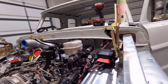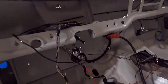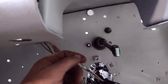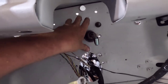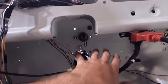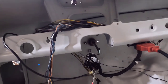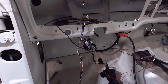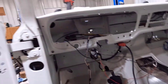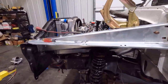I'll show you the inside. Up in here there are the bolts that go through the firewall, and then the nut that holds the hydro boost on. There'll be another plate in here that bolts the pedal assembly on, so it sandwiches it all together with the firewall. That's all tied into the firewall up here even with just these two bolts. I have this exact same setup on my Ultimate Highboy and it's worked great — that thing has fantastic brakes. These brakes are going to be even bigger, so hopefully it'll all work.